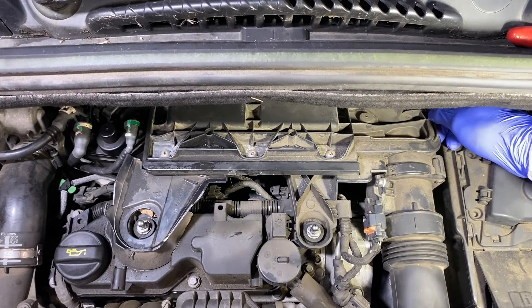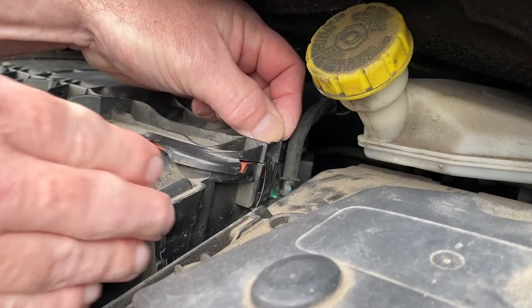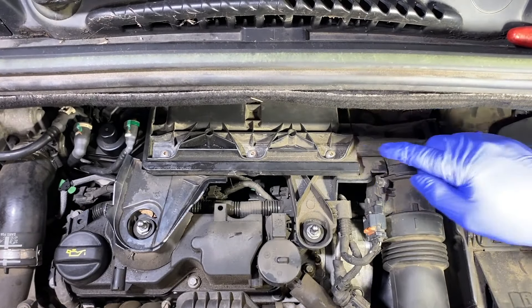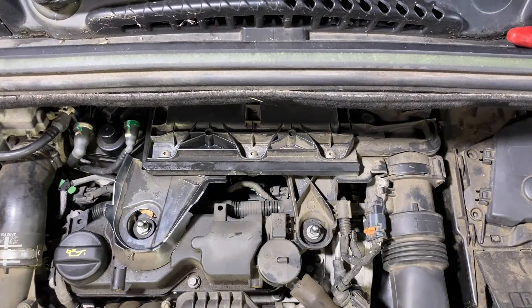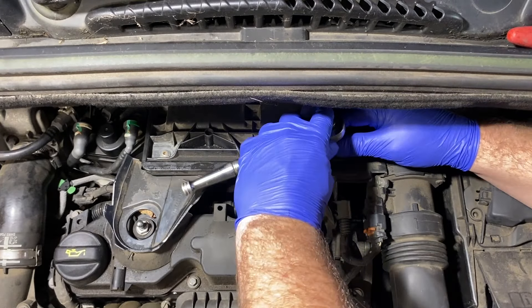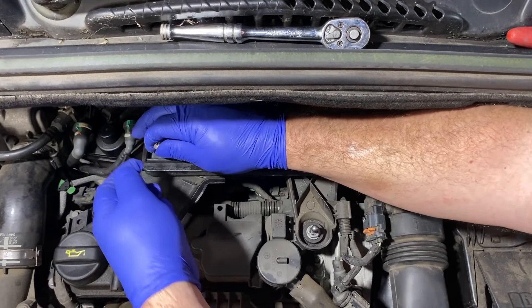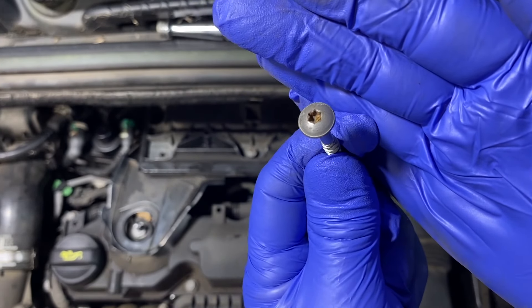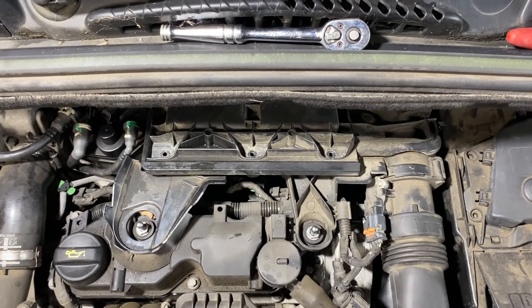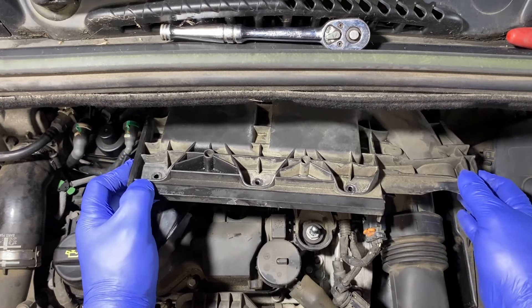So there's a clip there, a little metal spring clip. You've just got to flick him off and there he goes — you just pull him out to the side of the car. So that's the first job. The next is these three Torx bits; they're just T25s. Just a T25 bit — T25 self-tapping screw. So now what we do: get the lid, we lift it and we just pull it out towards us. It's that basic.